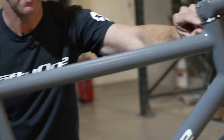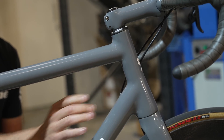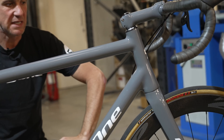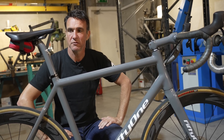We've got 25mm on the head tube, and we've also raised the down tube where it meets the head tube, just aesthetically giving you a far more pleasing frame. It's probably something more akin to maybe a 57cm frame when in reality I'd probably need something closer to a 60.